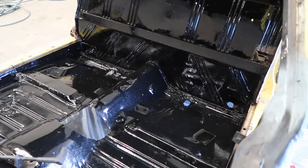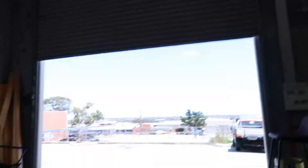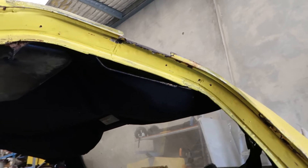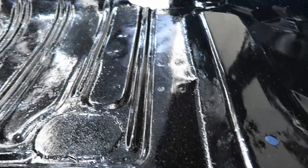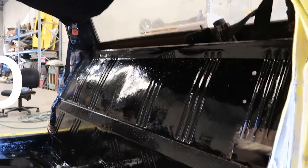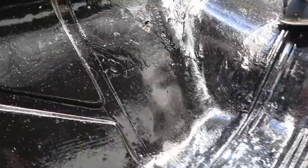The first coat's down, but I've got the door open to get some airflow through so the paint doesn't build up and overcome me. What it's done is the wind has blown in the hood lining and shaken all the fibrous crap from the hood lining down onto the wet paint. So now instead of a nice smooth black surface, it's got the texture of sandpaper. I really wish I had stripped out the hood lining before this, but I didn't expect it to be so bloody windy. That's coat number one done - I'm going to let that dry about an hour and then do the second coat.